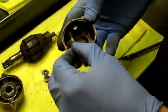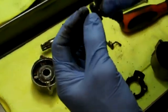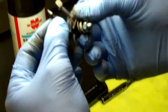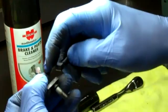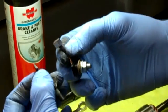You can see these brushes were left in way too long — there's hardly anything left of them. This is what a new brush is supposed to look like compared to what's left, which is worn all the way down to the wire. If the brushes had been changed earlier, they wouldn't have chewed up the armature like that.